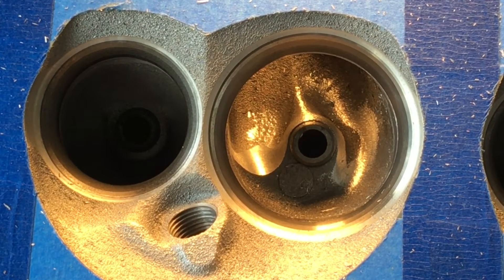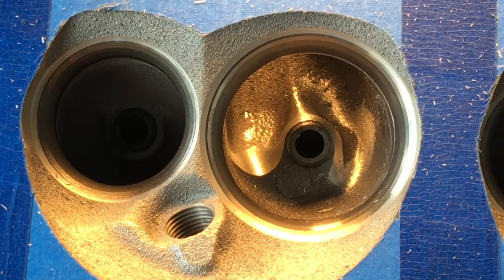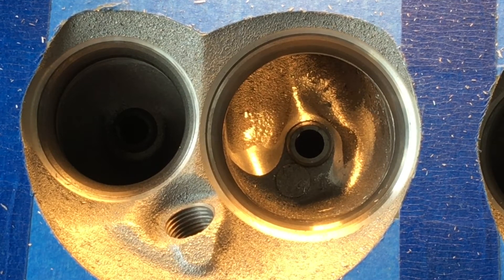The bulk of your flow gains come from your bowl work, your valve job, and your blending. The valve guide boss profile really helps in the higher lift ranges of your airflow, but it doesn't hurt to reduce that restriction because at all lift levels that air has to go around your valve stem, your valve guide, and the valve guide boss. The smaller the profile and the more efficient it is, the better it's going to flow at all lifts. People refer to having a skinny valve guide boss helping with higher lift flow, but in reality it's going to help you at all lifts.